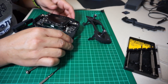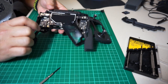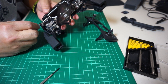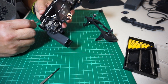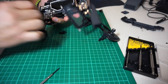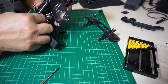Gently remove the clear screen cover of the LCD display. Next, you need to remove the LCD screen plate. To do that, you'll see the white ribbon cable clip — you need to remove that ribbon cable from the clip itself. Be really, really careful at this point. Take your time, don't rush, because this ribbon cable is very fragile. Unlock the clip and use your little screwdriver to gently push it out. You don't want to tear or break that ribbon cable.